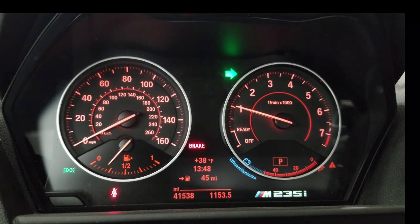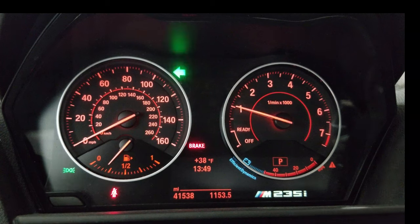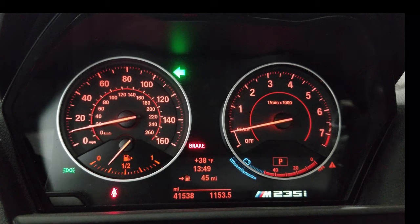I'm going to set mine back to map one since that's what I'm running. To get back from the tach to the speedo, push and hold the BC button for a second or two — both hazard lights and turn signals will flash twice, meaning you're out of the JB4 menu and back on normal stock gauge operation. Re-entering the JB4 menu: push and hold BC for seven seconds, and since I'm still on menu zero it's showing the tach on one, confirming I'm on map one.